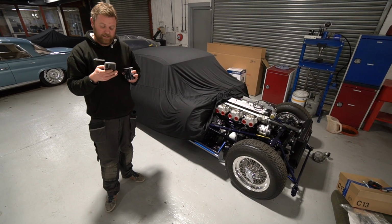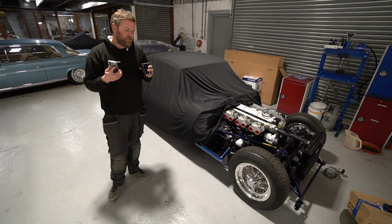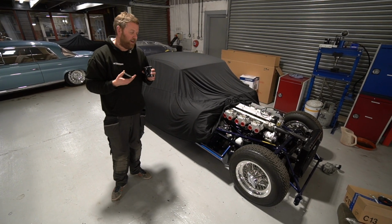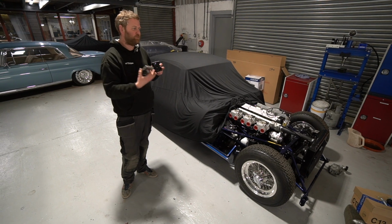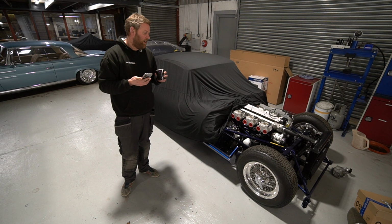And yes, although admittedly it does corrode over time, painted finishes on aluminium castings can sometimes look a lot worse. I've seen a lot of people just go silver paint this kind of thing, and ultimately it always ends up getting damaged, and then you get corrosion creeping underneath the paint, and that looks 10 times worse when you've got flaking off bits of silver paint on there.